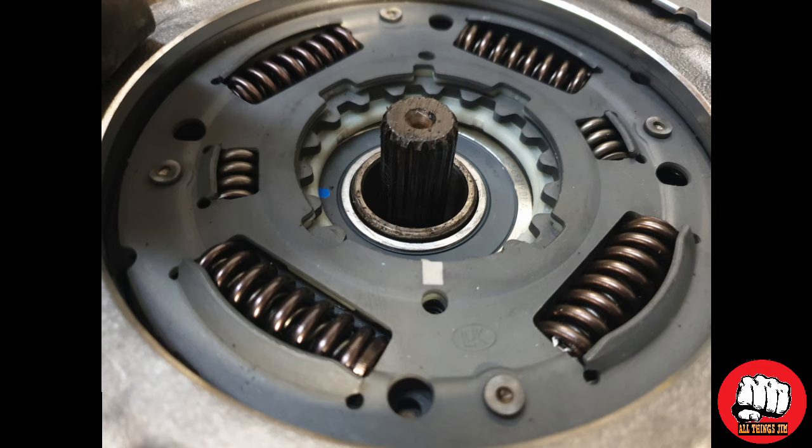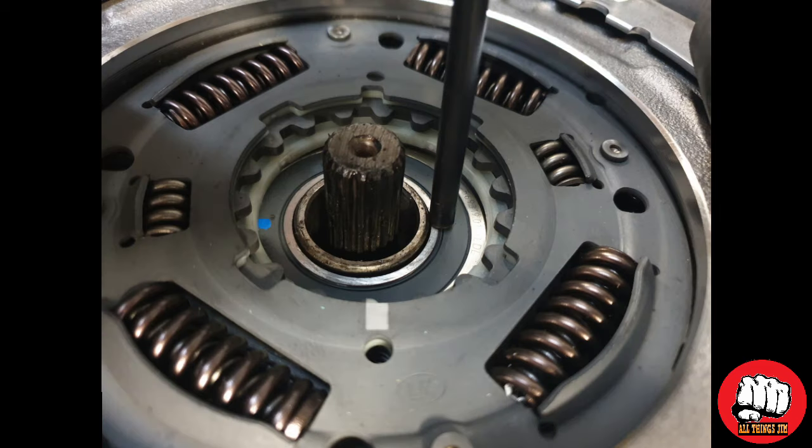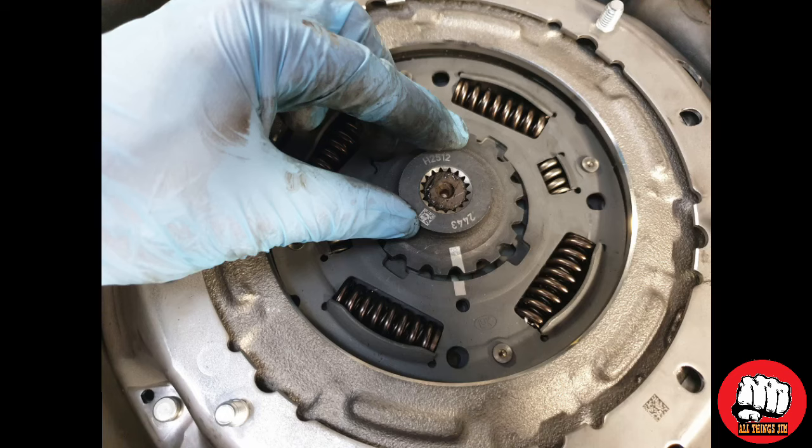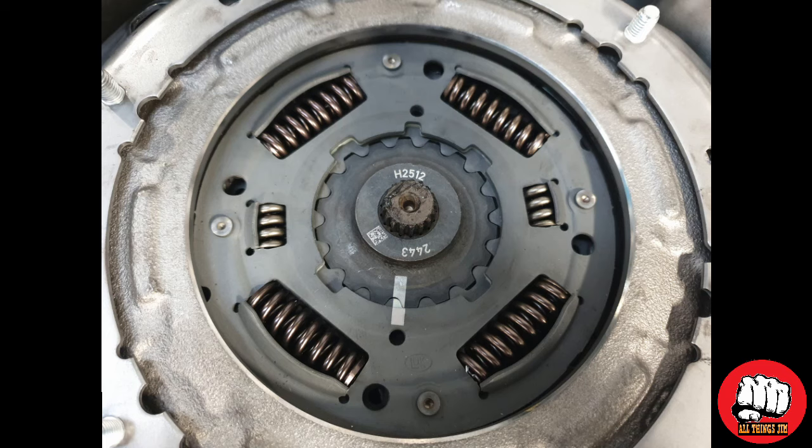Depending on how thick the wall is on your socket, you may need to use a punch to tap the clutch unit down the remainder of the way, as the clip sits inside a ridge. Once the clip is fitted correctly, you can then put the center cog back in, making sure the line lines up, then fit the new outer clip.